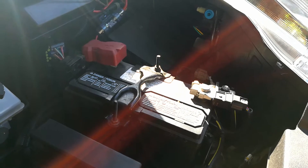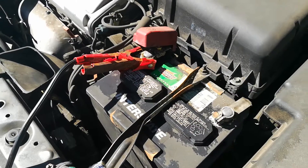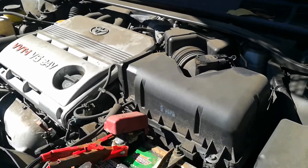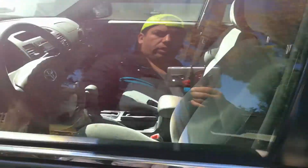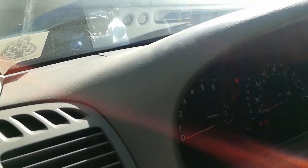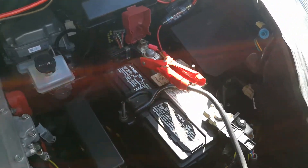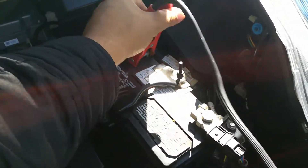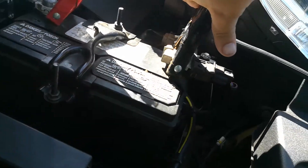Let me go ahead and get my jumper cable set up and show you what to pay attention to. This is the vehicle that's going to be jump starting the Leaf. We want to make sure that we don't put too much of a load on it if the Leaf's battery is completely dead. I've had some people give really bad advice about going to metal components — you can do that on some cars, but on this particular car you want to go straight to the battery terminal, specifically the negative post right here, and I'm going to connect it.